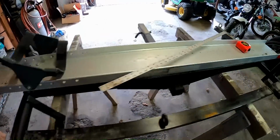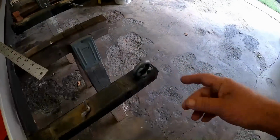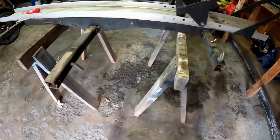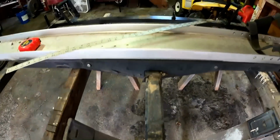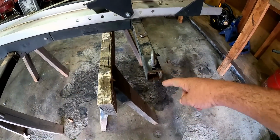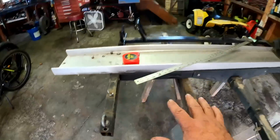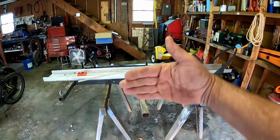And fortunately it didn't bend it, because, let's see, which way am I looking at this? Yeah, up here to the back bumper, to keep this stable, not wobbly and shaky on the back of the Bounder. This is where it goes in the class 3 hitch on the Bounder, so it slides back into the Bounder this way. And then on either side, I have a bracket also welded to that back bumper. It sticks out. You might have seen it out there, and then it bolts to that. So that really keeps this rack from shaking this way and this way.